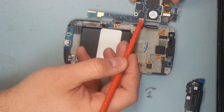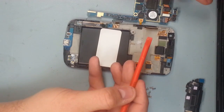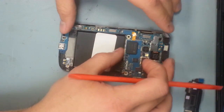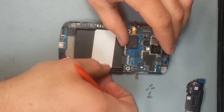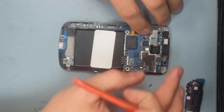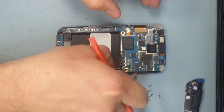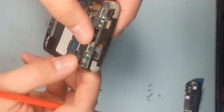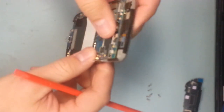To put the motherboard back into place, there is a ribbon cable that attaches to the bottom of the motherboard, so clip that on first. Then fold the motherboard over, making sure to keep the other ribbon cables on the outside. The top of the motherboard needs to slide in first — there are little plastic brackets along the top of the phone. Wiggle it and press it in underneath those brackets so it sits tight against the phone with no wiggling room.